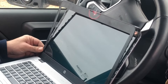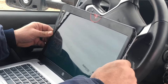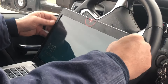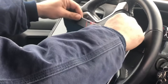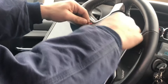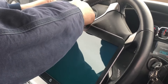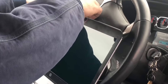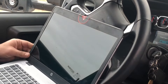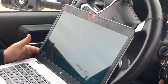This is one part that you do want to be careful of — you just installed a brand new LCD. They do kind of go down and you'll notice it's like a large clicking sound. Believe it or not, I have pushed a little too hard before and have actually damaged the LCD. So when you're clicking these in, don't rush it. Take your time, make sure that you're hearing every little click and you're not putting too much pressure on the LCD. Where the bezel is around the LCD you shouldn't have any problems, but kind of in the middle on each side — that's when you get close to the LCD.